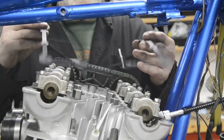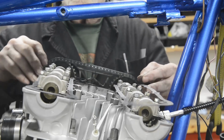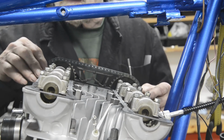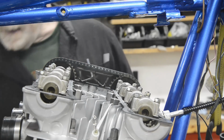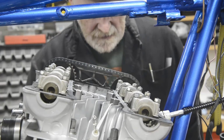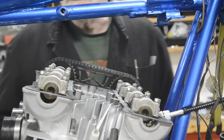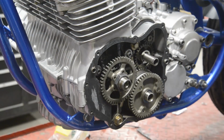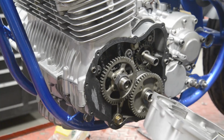Now then, we can put this gasket on, which I notice doesn't have any extra large holes for where those two dowel things are, and then I can put the valve cover on. So let me grease this up, put the valve cover on, and then we'll do the exhausts, I think. Now I'm not sure if the exhaust pipes would make it awkward to get the wires and stuff on, so I'm going to do this outer cover first. So that goes on.